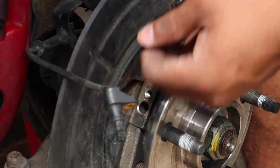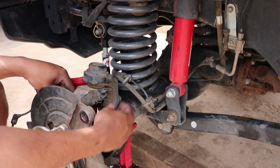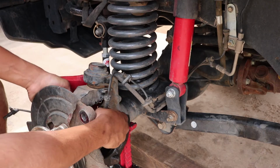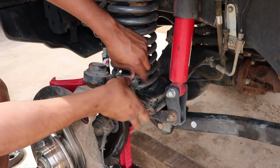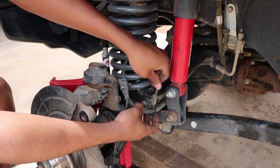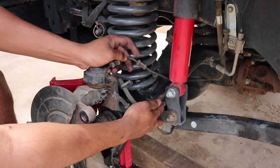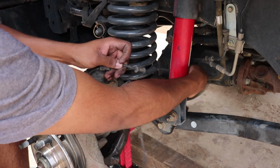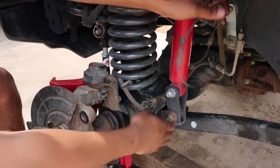There you go. Next, you want to begin by disconnecting the speed sensor from the brackets. And we already did the one up here, and they're just rubber fittings, so you just want to pull it off. And then you can snap it out of these two parts right here. Pull it up, out, and get it around.